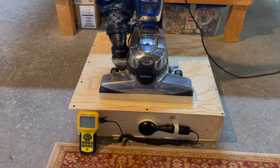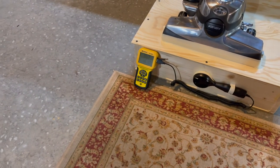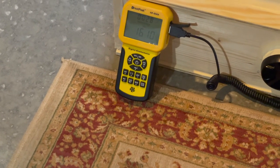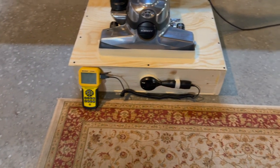So you can see a pretty impressive result of 161 CFM. You can see on the hold peak there. Let me just zoom in there for you. 161 CFM. And as you saw, we're at around 121.1 volts or so under load, which is pretty normal.